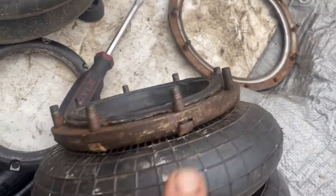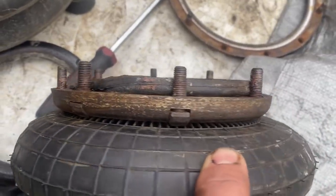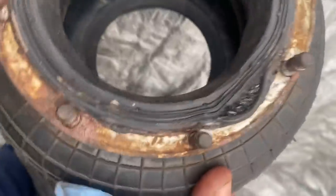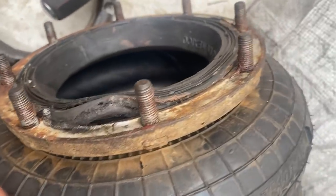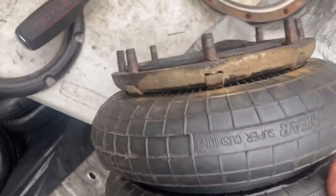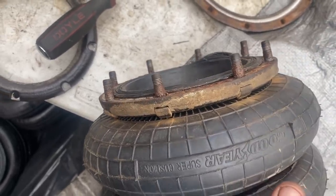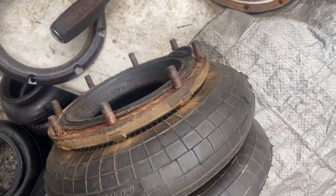Tyler had to take this airbag off that they put on. If you look at it, you can see how skinny it is — they didn't have it properly seated on either side on the ring. On the other side, they actually damaged it putting it on. That's a brand new airbag and it's screwed. I don't know if they were trying to bang on it with a screwdriver or something, but you can see it's not seated in the ring correctly. So we've got to replace it. We're putting it on now just so we can air the bus up and move it, but that did not get done right.